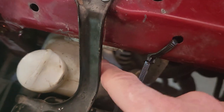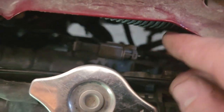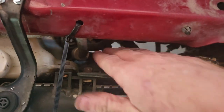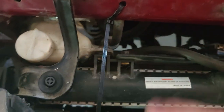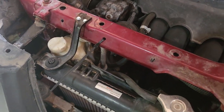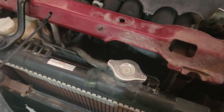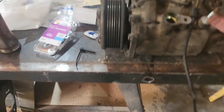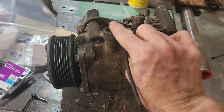With the top bar out, you've got one bolt for the coolant reservoir, and then a bolt here and a bolt here for the fan assembly. Don't forget to unplug the fan assembly plug. With that lifted out, you have all kinds of space to get underneath there — really you should be able to take the compressor out in 15 to 20 minutes max once you know how it goes together. That will also let you easily get to the hose connections on top of the compressor.